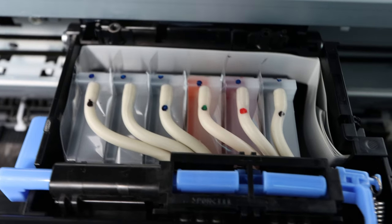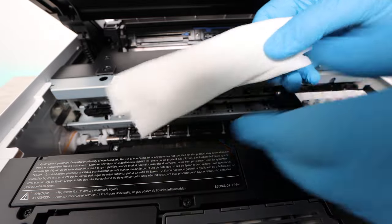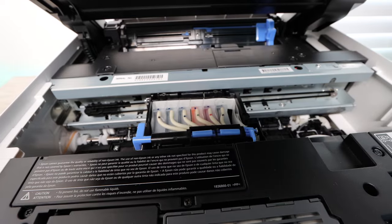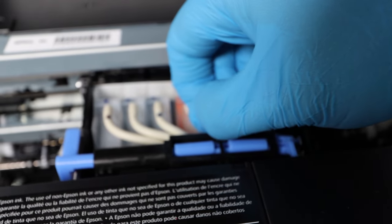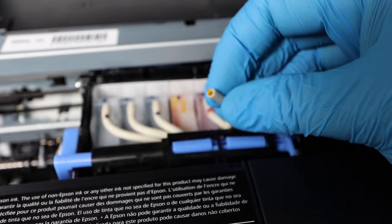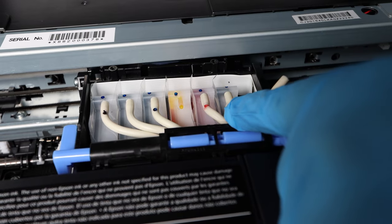The best way I can describe the printhead is it's basically the heart of the printer. You can see there's different tubing connected to the printhead, and that tubing represents a different color. It's actually color coded — if you look at the diagram at the portion of the printer where you install the ink, you'll be able to see the color pattern you need to follow. I've identified exactly where yellow is, and now I'm unplugging and pulling out that tubing. It's very easy to pull out — just do it very gently and pull it off to the side.